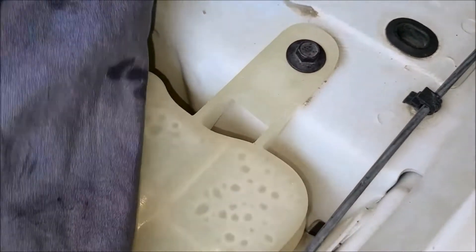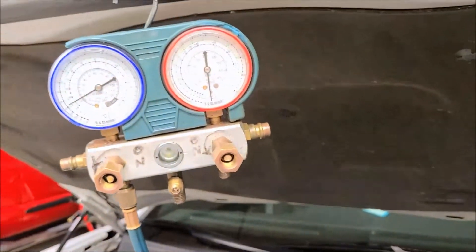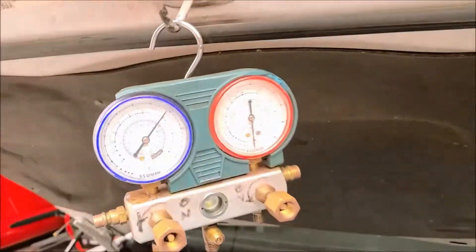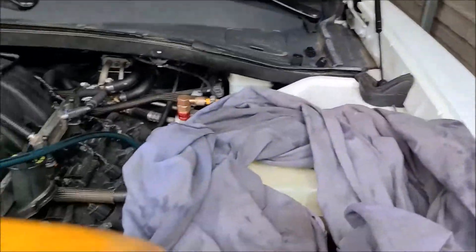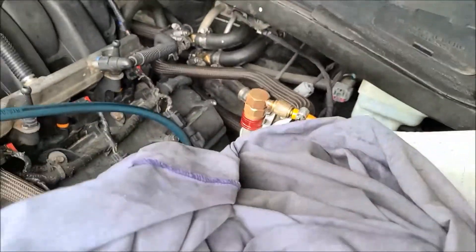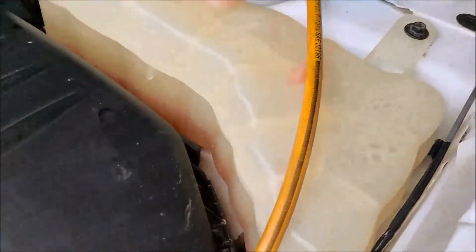Instead of using a quarter or half of the bottle, I used three quarters. It's an expensive experiment to some degree, but it's better than taking the dashboard apart. My gauges say I still got 10 psi in there — let's see if I can push this in. I got 80 psi still showing on blue, even though I'm hooked to red, so it did blow that red stuff in there. Looks like red refrigerant oil. Whether or not it works, I don't know, but it's warranted to work. So I'm going to redo my hoses and put them back properly so I can read my numbers and get the right charge on all this.